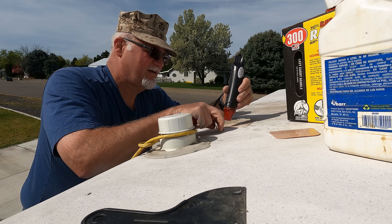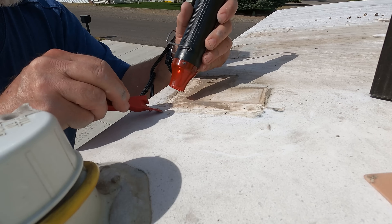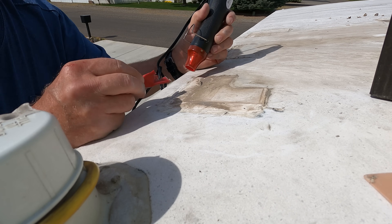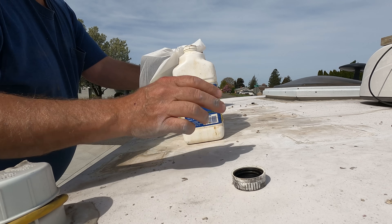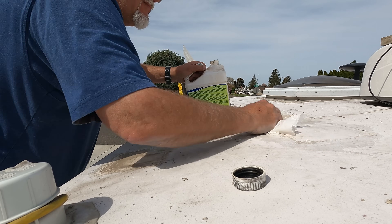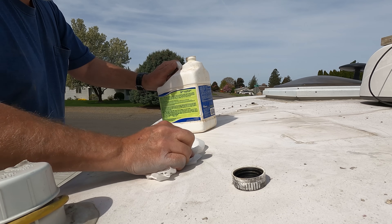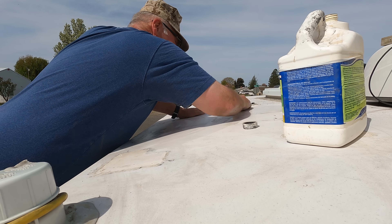Too bad I tore the roof there a bit. Oh yeah, that's coming off easy, folks — ooh, that's hot. Man, that's perfect. Next step is some mineral spirits. I happen to have some. We'll clean the whole roof off — these roofs are always kind of chalky. You've got to have the roof as clean as possible in order to put the butyl tape on. Looks like it's working pretty good, folks.